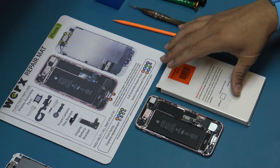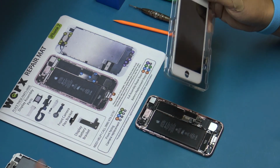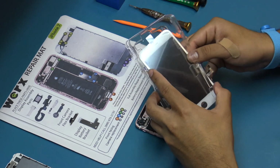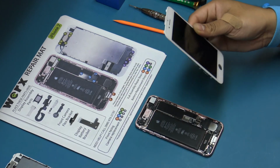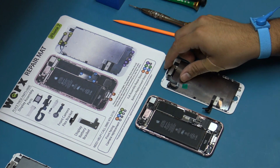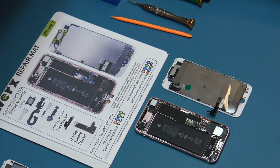First, you will identify that the replacement part is fully functional prior to full install. Second, replacing the part will resolve the customer's issue. Some issues are board related and may not be repairable through part replacement. Third, you will be able to identify if damage was caused during the rest of the repair, as at this point the part is fully functional.